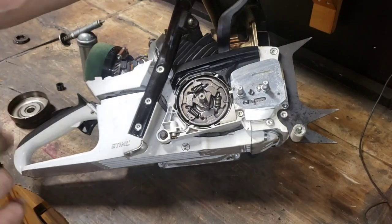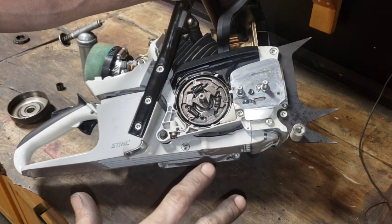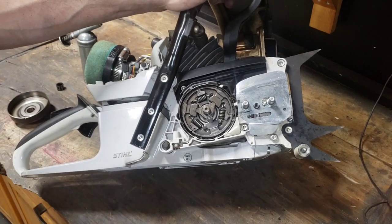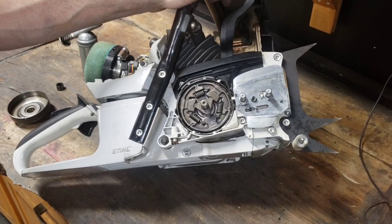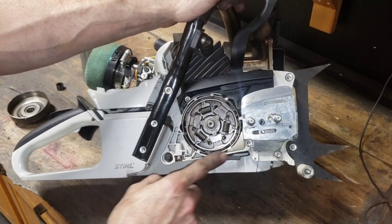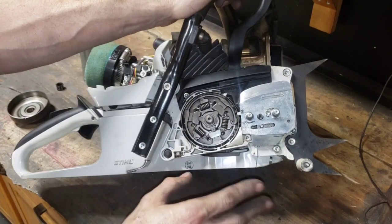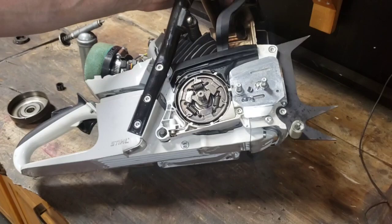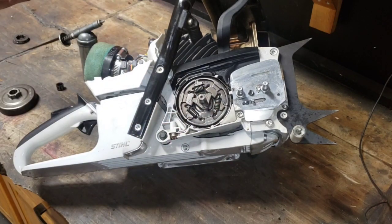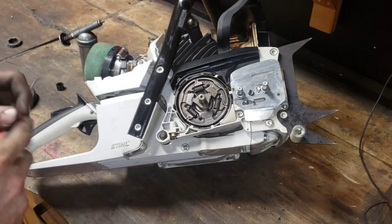I got everything cleaned off. I treat things situationally - with something like this there are carb kits and stuff, but I follow a basic method every time. Since everything was replaced, it's looking really good, performed really well, did a lot of testing, worked it really hard, nothing is getting hot. Another thing I want to mention - why I don't think the chain brake was left on - none of this area around here got hot. The clutch got hot, which makes me think it was something in the spacer or worm gear - maybe just a little bit too much material from factory. I really don't think this was operator error, but I'll be completely honest if I thought it was. I'm not going to pop the clutch off because if taking things off isn't necessary, don't do it.